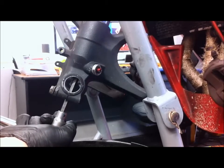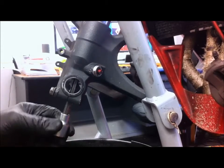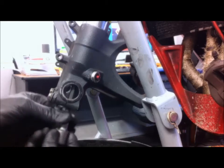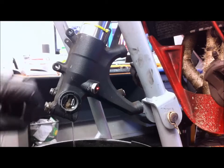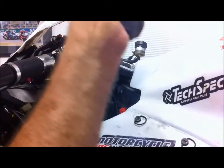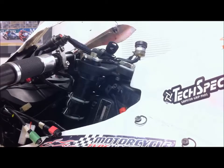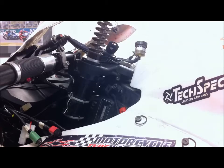It's not done up very tightly, just have to loosen that. Now I can take this out and oil should start running out. That M8 bolt can't come out through the hole in the bottom — it'll just sit like that. Now we're back up to the top again and I can unscrew the cap. That's loose, and now I should be able to pull that cartridge out because the screw in the bottom is completely disengaged.